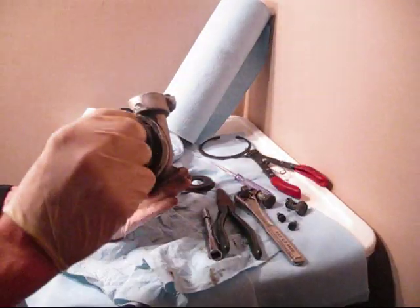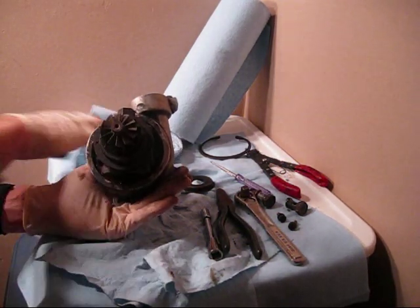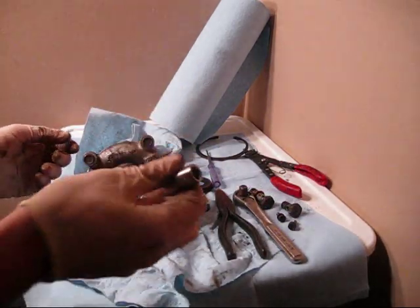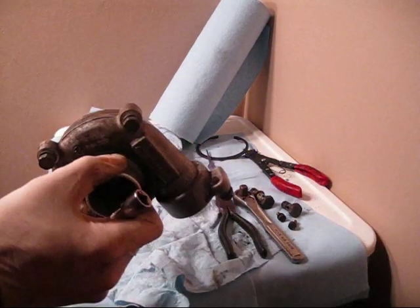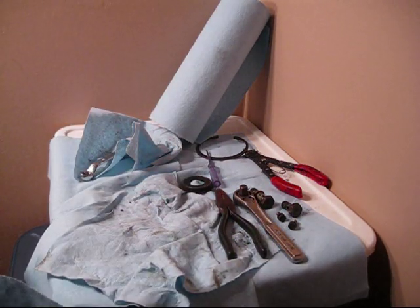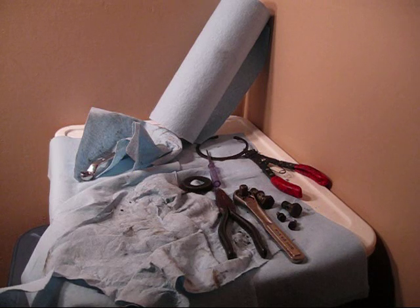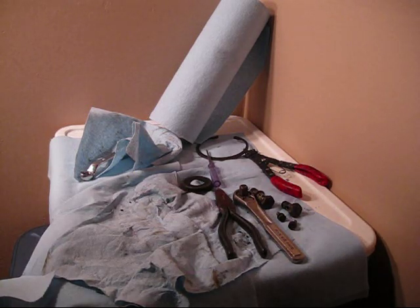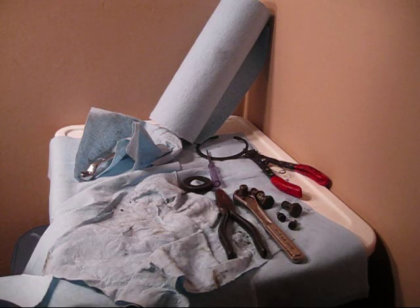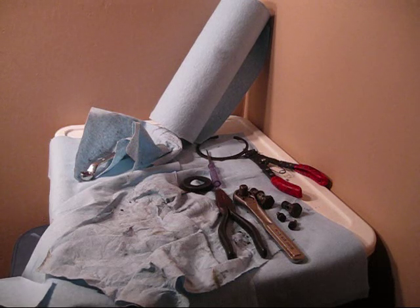Once you have that snap ring off, put a 12mm on this side. What I do is loosen the 8mm bolt on the compressor side and then leave it threaded on just a little bit so it's resting right on top of the compressor wheel. Hold it between your legs and with the extension and 8mm socket, hit straight down so you basically send the turbine shaft and the compressor wheel as well as the center housing rotating assembly all straight down, separating it from the compressor housing. That's what you can hear me tapping — hitting straight down with a hammer on the extension.